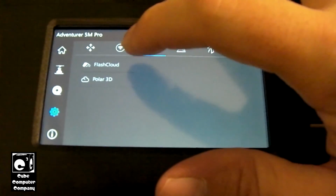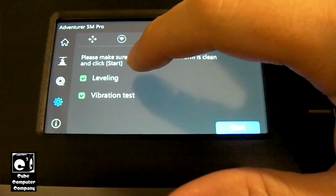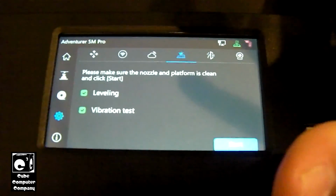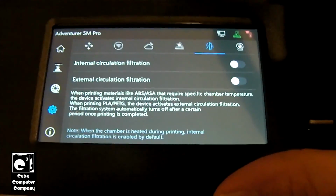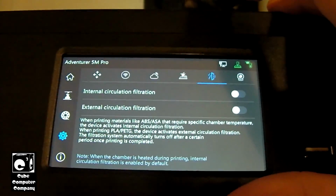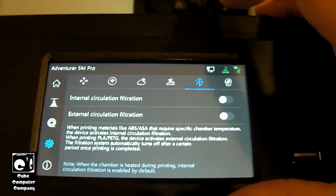So we have Flash Cloud set up and Polar 3D set up here. Here is where you would redo the leveling and vibration test. I would suggest you do this if you move your 3D printer to a different location. And also, I think it'd be a good idea to do this after a firmware update applies. Based on what I'd read online in an Amazon review, someone had downloaded a firmware update. Well, actually, the printer automatically found the firmware update and downloaded it. And after it installed it, when they went to do a print, everything was way off, and it was causing the hot end to actually embed into the bed, which is not good. So